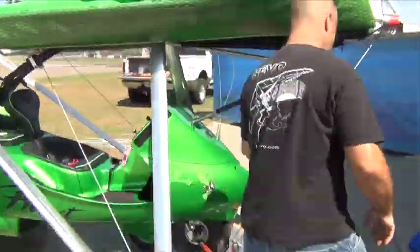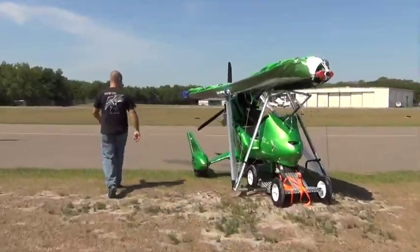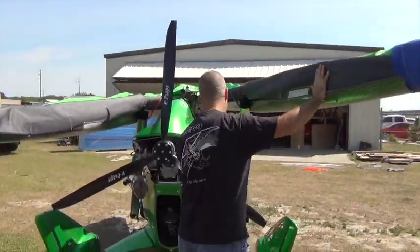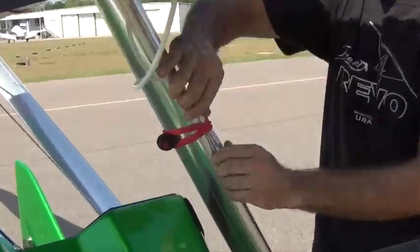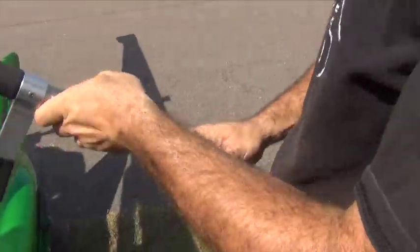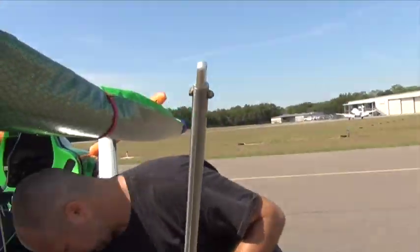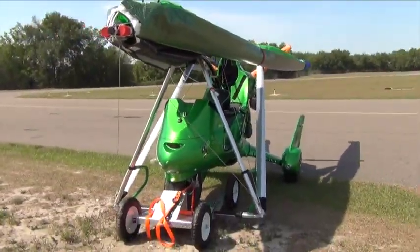We've officially released the brake and now we can move this thing — it's moving as a unit. The three blade prop works really well if your trailer is tall enough to clear that top prop blade, but you can see that a three blade can really be a pain. You want to tie up your wing cables and use a bungee so they're not clanking around. The compression strut you should really remove — that'll take any stress off the bungee cord and the folding joint. Stow it separately, not on the trike. For a short trip you can certainly leave it in.